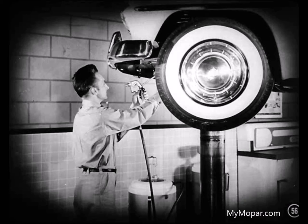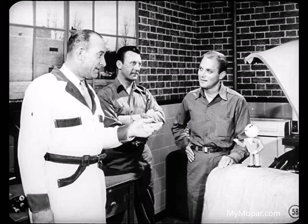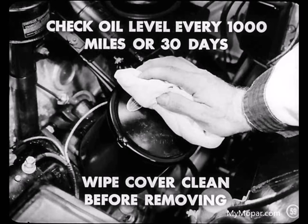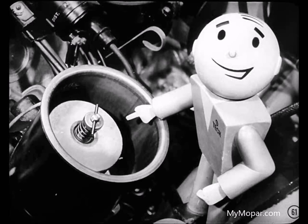What's the story on maintenance of the system? Proper lubrication of the steering gear linkage and front suspension is important for any car, but especially important on cars equipped with power steering. Every 1,000 miles, remove the filler plug and check the steering gear. Add fluid gear oil, SAE-90, if the level is below the filler plug hole. Don't use a pressure gun or you're apt to force the oil up into the steering column. Check the oil level in the power system reservoir every 1,000 miles or 30 days. Before removing the cover from the reservoir, wipe it clean so no foreign matter will get into the reservoir. Then remove the cover and check the oil level. The level should be up to the level mark on the reservoir. Don't disturb the filter element — you don't have to change it, so leave it alone.